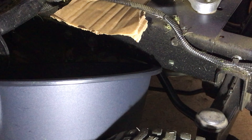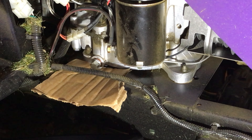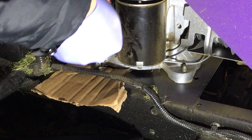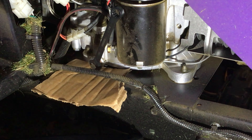Now you might be able to see here that the bolt in the oil hole is square as opposed to hexagonal, and so what I think is the easiest way to get this out is to just use an open-ended wrench like this. 7/16ths is what I'm measuring it, and that looks like it's going to fit. So I'm just going to use that to remove it and tighten it back in — let's give it a try.